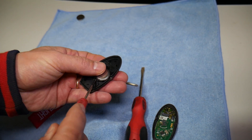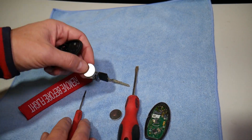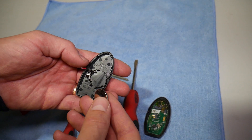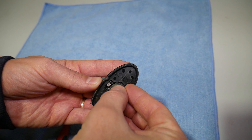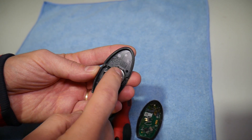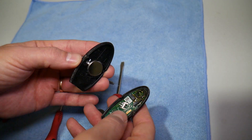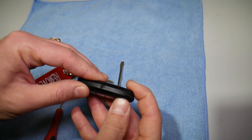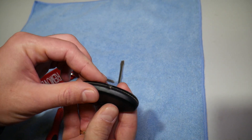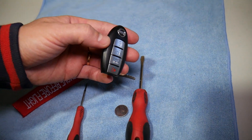Go ahead and pull the battery out, then get the replacement battery. You need to go in at an angle — at an angle under this plate. The negative terminal of the battery should be pointing up. You can see the picture here that explains the correct position. Align everything really well, and while holding one side down, start pressing everywhere until everything is closed.